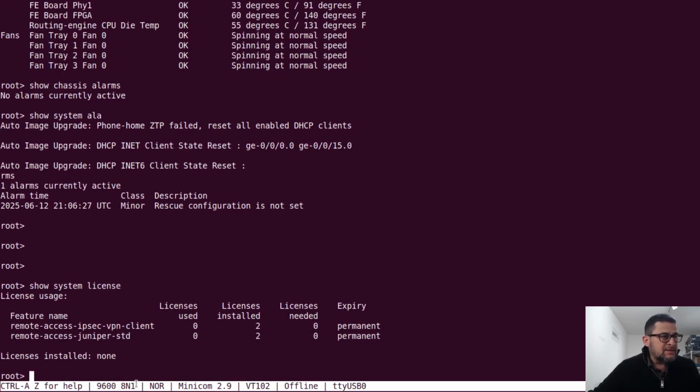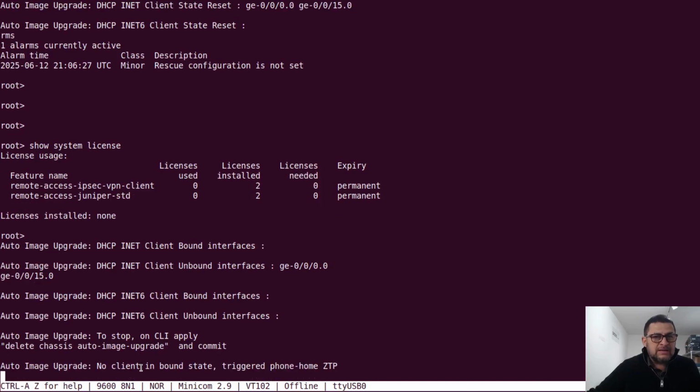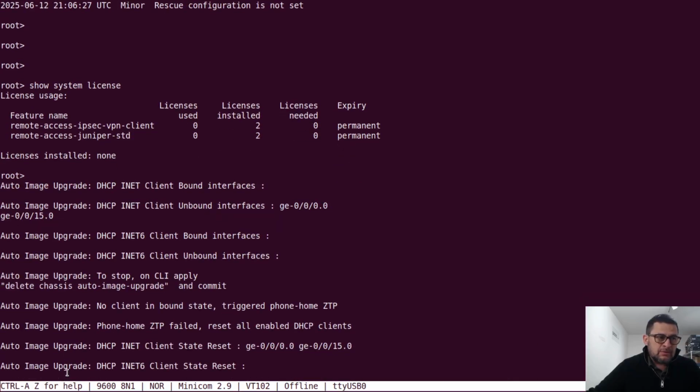So basically that is how you restore the image on the SRX 1500. At this point I didn't have any choice but to erase everything, because I tried to remove the node from the cluster, which is basically possible, but in this case it doesn't erase any configuration of that. So I forced the unit to install a new operating system, and that's the last resort, of course, because this is not an upgrade process. This erases everything on boot flash.